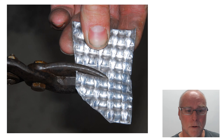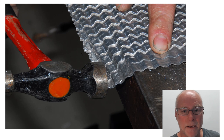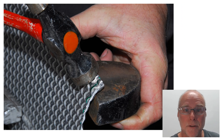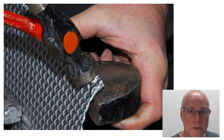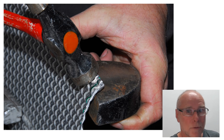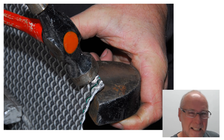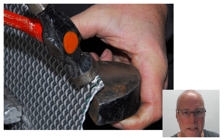How do you work with it? The good news is you can cut it with tin snips, as I've shown here. You can shape it with a hammer — here I'm shaping the edge by wrapping it over the edge of my bench and just hammering it to form a fold, to form a downwards-projecting edge. And here I'm using a dolly, just the sort of dolly you'd use in normal sheet metal work, to form it to a different shape. It's quite easy to work with — a lot easier than typical sheet metal, and vastly easier than trying to make the heat shield out of stainless steel, which keeps springing back. This is the material to get, and then it all becomes reasonably straightforward.